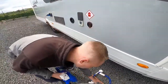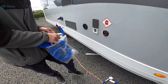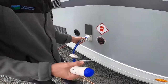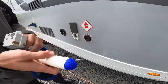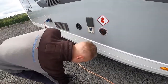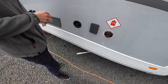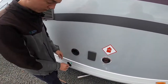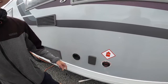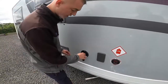If you are wild camping, or you didn't want to move the van and wanted to bring water to the van in a collapsible bucket, an aqua roll or container, you've got this submersible pump — connect the same way and you'll hear that pump kicking in and out. Just pop the pump into the water and suck the water up into the van. Alternatively, you can fill the normal way with the flat end of the hose pipe into the fresh water fill — buy an ordinary hose, put the flat end in, and remember to buy the quick-release connector and the screw-on end because it's a brass tap.